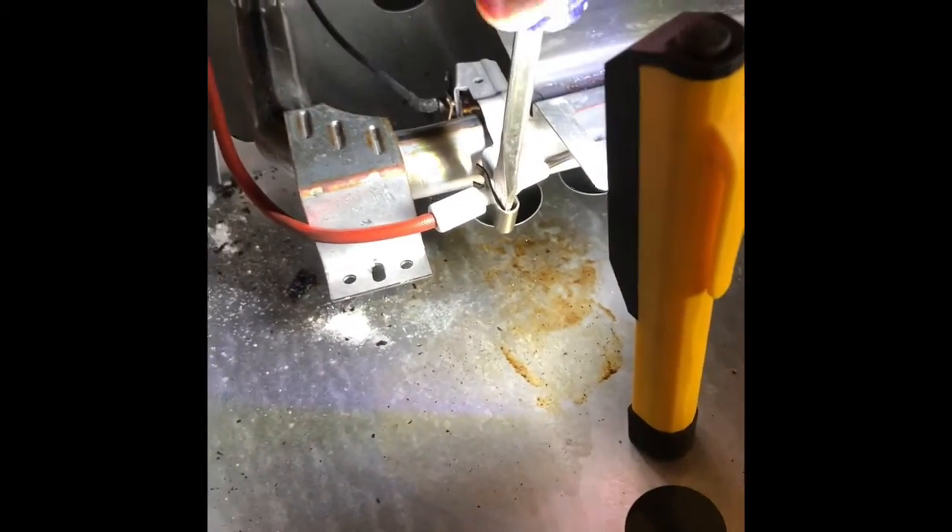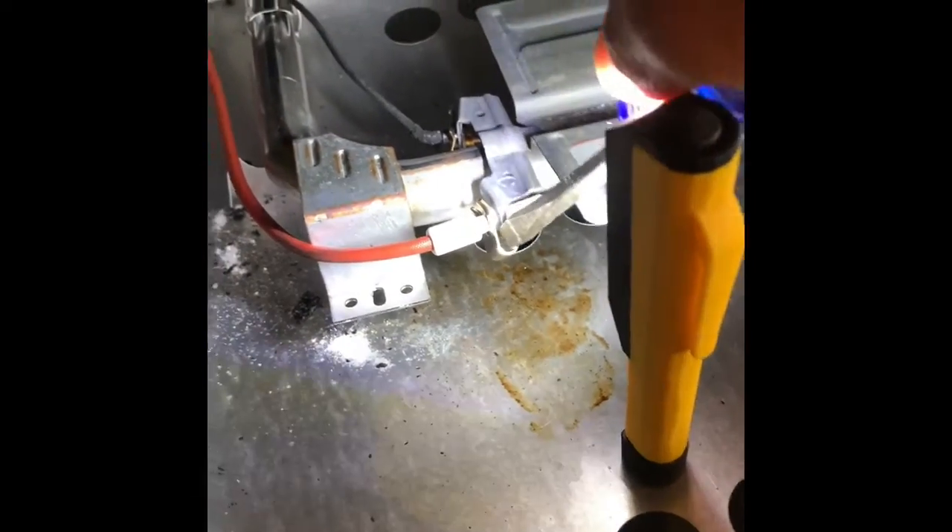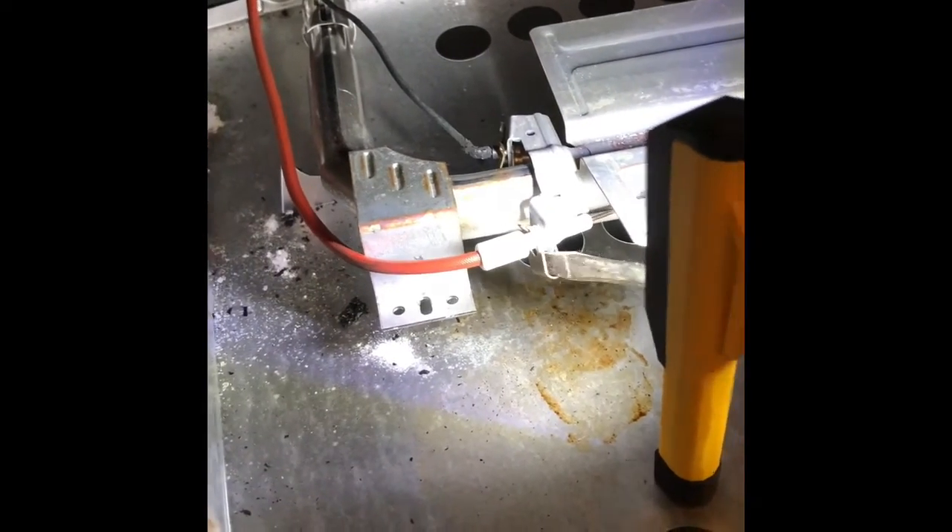These are kind of rare ovens — they're really nice. I don't see them that much in the United States. I'm putting a standard head screwdriver in to try to pry this clip off. Be careful because it's ceramic — don't put too much pressure against the ceramic.